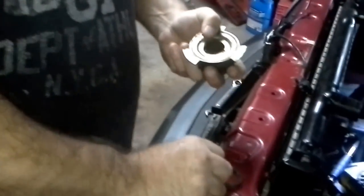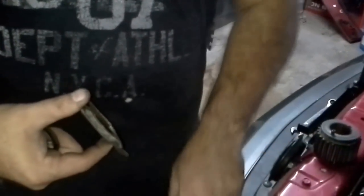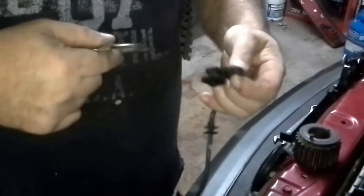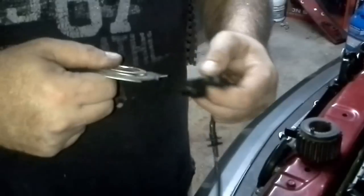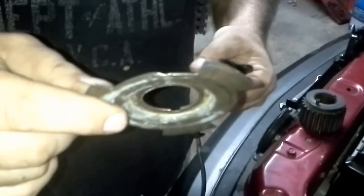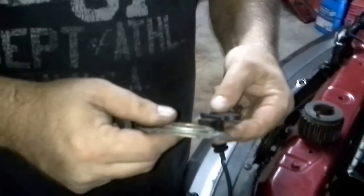How this is designed — this thing just rides on the crank wheel and the camshaft, on the end of the cam. How it works is: there's a little magnet in here. So every time the wheel turns around, it passes through there and it causes a current to come on and come off. And you'll notice there's a little timing mark on it. The computer is able to isolate the position of the crank and/or the cam, and therefore it knows the car's in time.